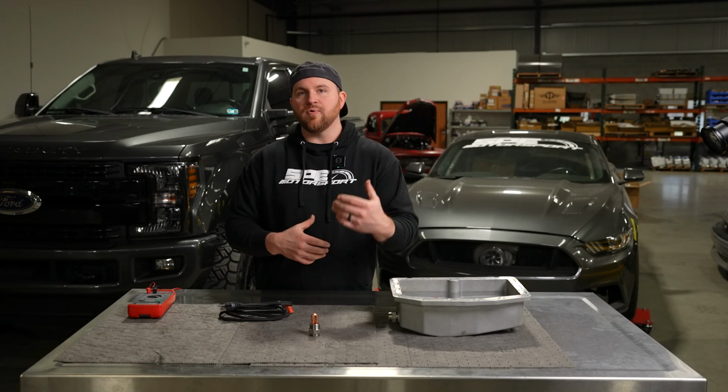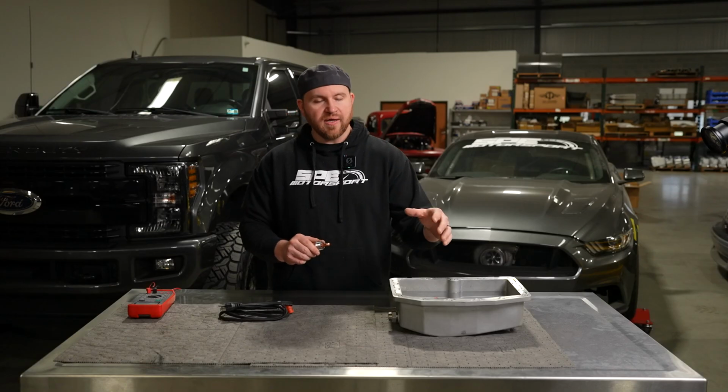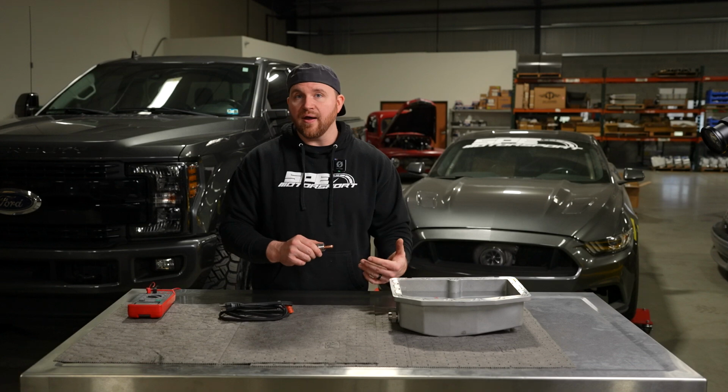If you're plugging a block heater in and leaving it on for a long period, you're heating up a cooling system. So you're heating up the coolant in the engine, which is regulated by what? Radiators. If you walk past the front of a truck that's been plugged in for a while, you'll actually feel heat coming off of the radiator, and what that's doing is regulating the system. That element isn't going to over temp because these elements have a temperature limit. If you're leaving it plugged in for a long period of time to where the element can actually get hot, it's going to burn out because it has an operating range.